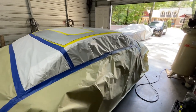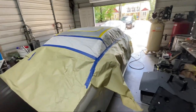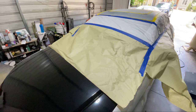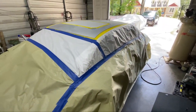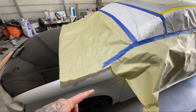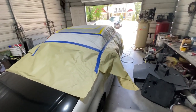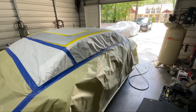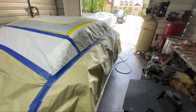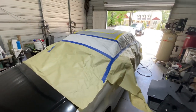Now the top of the car's taped off. You can do this with newspaper, whatever. I'm just lucky enough that I get huge discounts through 3M. Not sponsored though. But if you're at home, all you gotta do is get some sheets or something. Just wrap the car up, use newspaper around your painting area, whatever. Just make sure the car's covered. First is trash, one reason. Second off, you don't want the front of your car to be oversprayed or the back or the sides or whatever.